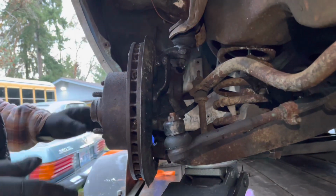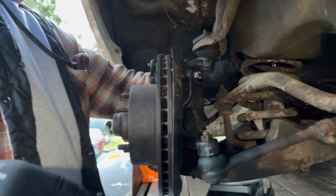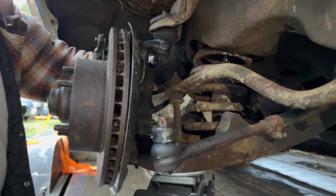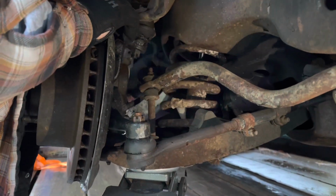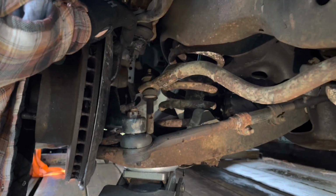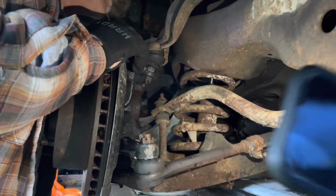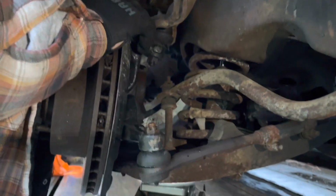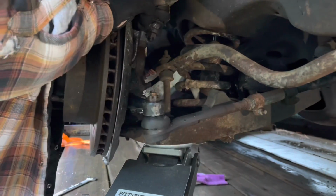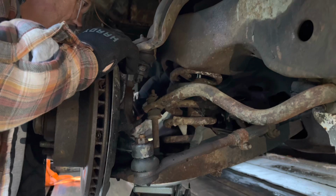You see how they're just snug? Mm-hmm. Nothing's tight. I'll tighten some more, put the cotter pin in the hole, and bam. Oh, yeah, I remember. People know, don't take the shock out because then you could kill yourself with the spring. So the shock will keep everything in your face intact and all your dental work on point. Ain't that right? Usually, yes. For the most part.